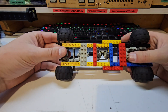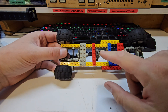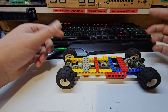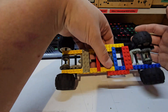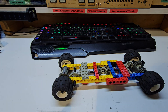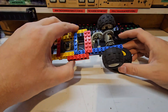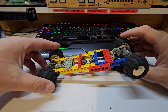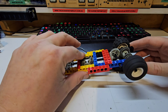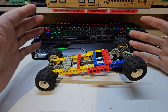That knob on the dash operates an air actuator that locks this differential. When you're off-road, that's perfectly fine. It basically takes this whole differential out of the equation. Let me show you what can happen when you're off-road and you don't have the center differential locked. If you're trying to climb over an obstacle and you get one wheel off in the air, that wheel is going to spin because the center differential is engaged — that's a bit of a problem.